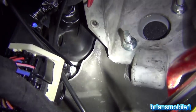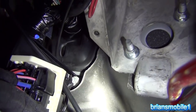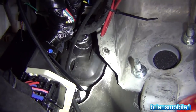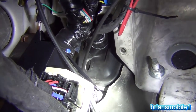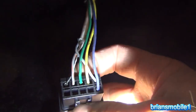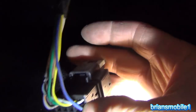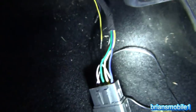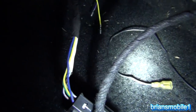Here's a view of the harness from the other side. You can see below that little tear-shaped thing — that's where you're trying to feed the wire harness through, but it's too tight and it just won't fit. If you go knifing through this thing any old way, there's a bunch of wires that do all kinds of mess up inside of there. Now that you've got two rubber dams to get through, I'll leave it to you how you do it. Once you've got the plug put in, it should look something like this: gray and blue, yellow, green, gray and orange, bare, and then blue at the bottom — with the buckle at the top. When you're done, just shove the thing over so it's flush on both sides, plug it in, and this goes up to the radio. The only wires used out of all of those are the two gray wires and the bare.